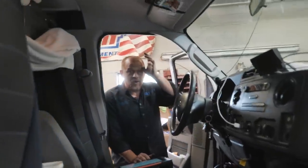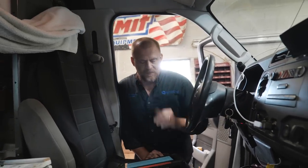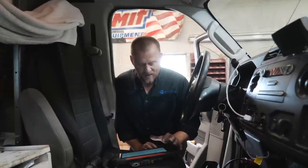I'm good with that. That was a long enough run time to say we most likely have spark. Let's continue on this fuel pump path. Let me ID the vehicle and then see what codes we have, and we'll go from there.